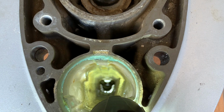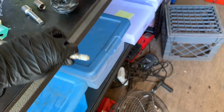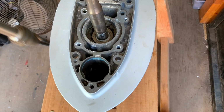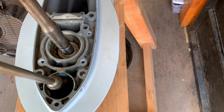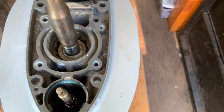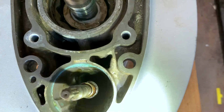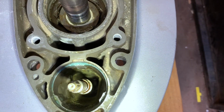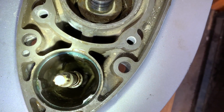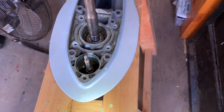So remember, you wanted to turn towards the inboard side, which is going to be this side, and that's where essentially this little part, that's your shift shaft, is going to have to come down here, inboard side, and go in that Mickey Mouse hole over on the right. Which is hard to see, but you can see it's in there if you were here. Anyway, so that's in, and the other way you can tell is look at the flat side of this. It's facing the inboard side, so we did the right thing. When we shift it back into neutral, it'll be facing dead ahead.